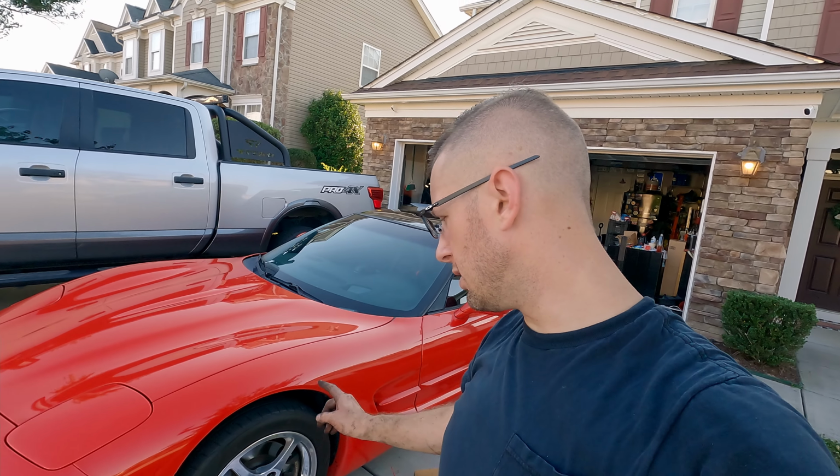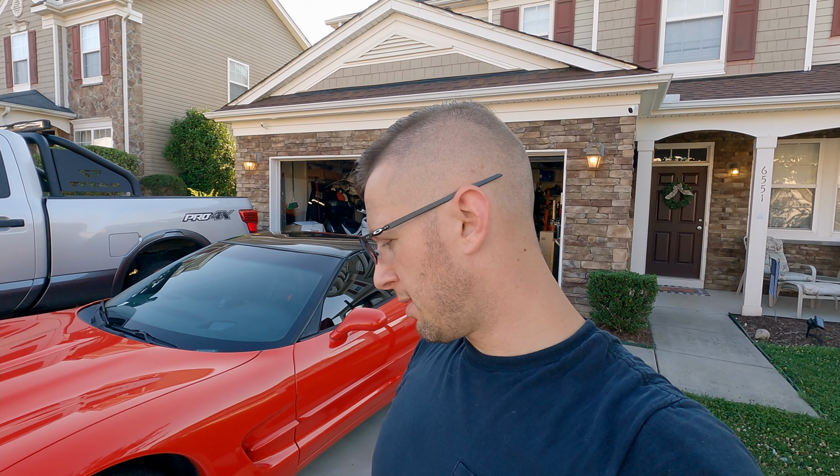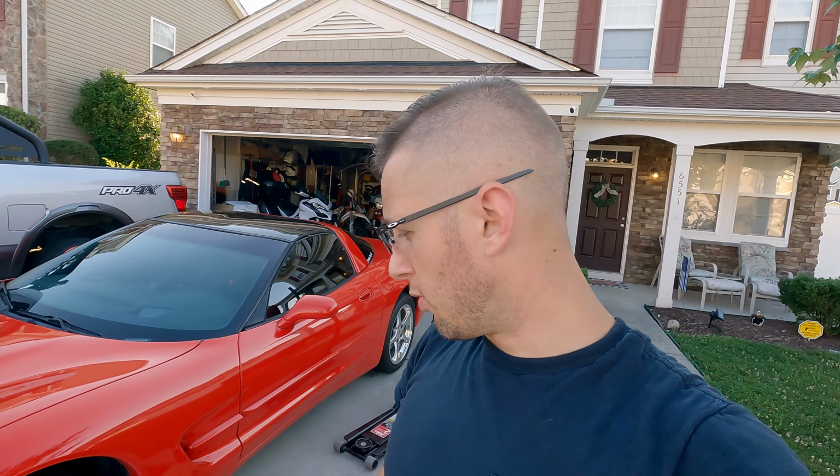That is it. New brake pads are on. If it was replacing rotors, it would just require one extra step of taking those caliper brackets off first. One thing I'll note is that the hardware on the front calipers was actually a 15 millimeter is what fit. I don't know if those are aftermarket bolts, or if they're more rounded off than the back, but the back was 5/8, the front was 15, for whatever that's worth. But we were done.